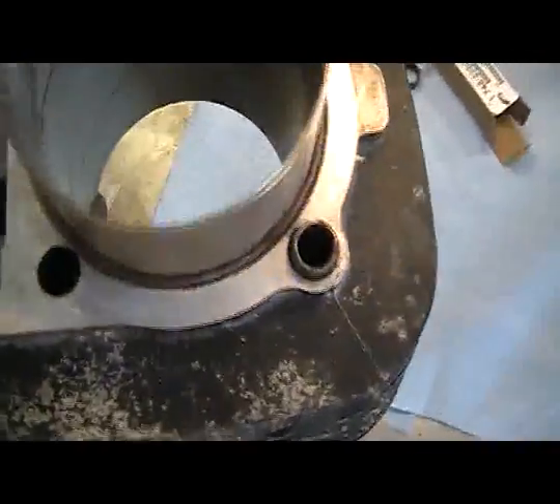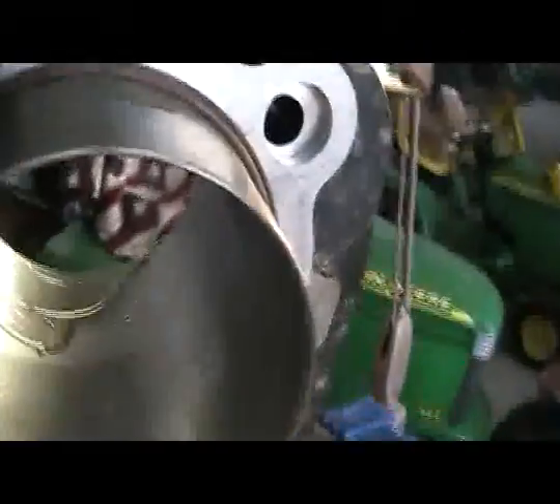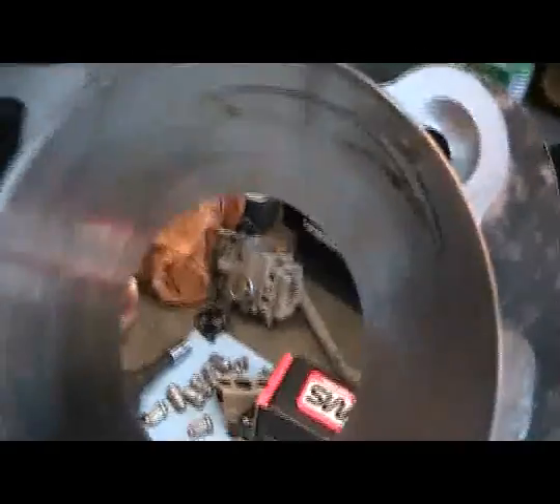The piston's back in the four-wheeler and we've got the cylinder cleaned up ready. We're going to put our new o-ring in. You can see there's oil — put some engine lube oil in here and wipe a good film of it around the cylinder so when we go together it helps aid with the rings. Now I'm going to put the cylinder on.